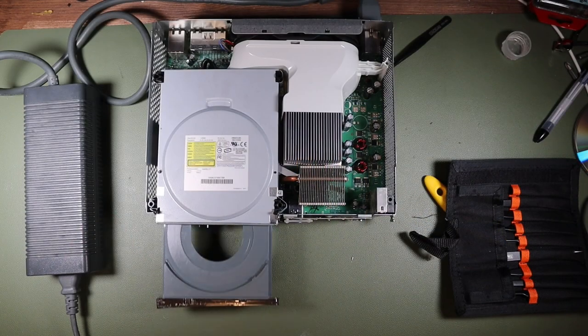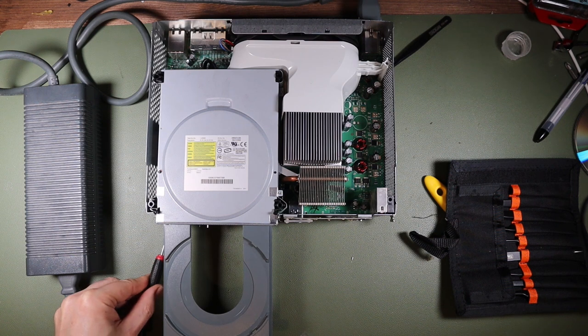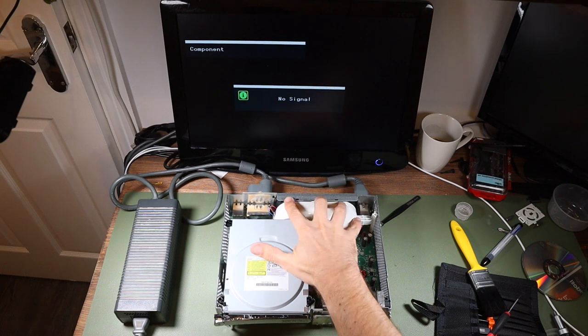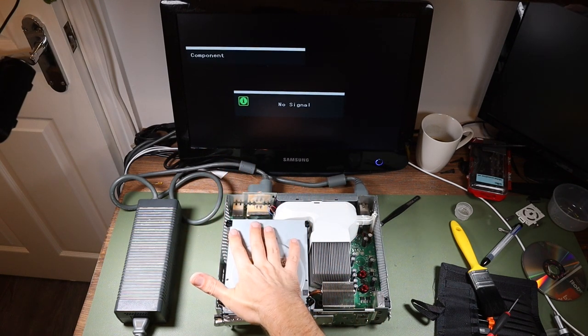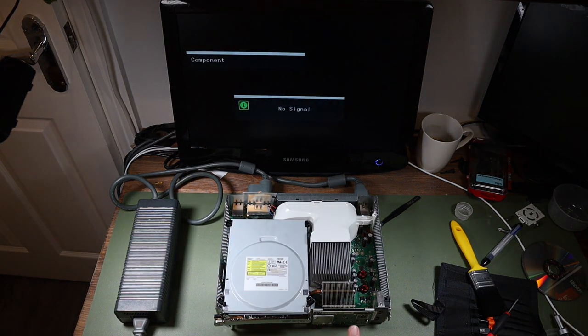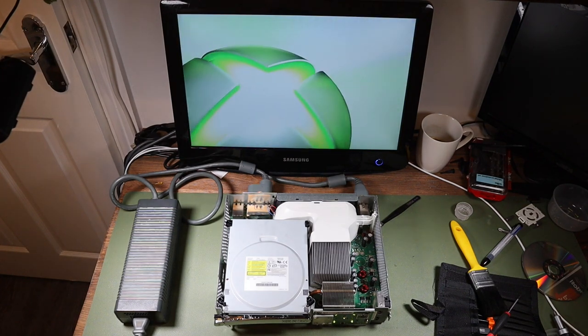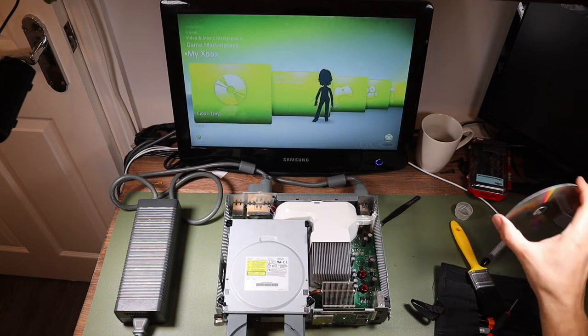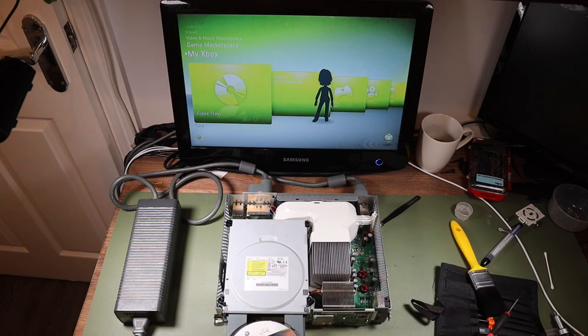Let's try it — excellent! And again — fantastic! I did notice the shroud was in the wrong place, so I reseated that and the disk drive is now in a better position, and I put the eject button in. Let's try it again — excellent! Now we get the startup screen, the drawer opens, and I have one game disc — Halo 3. Close, it's reading the disk. Is it going to read the disk? We did clean the laser. Come on — yes! Play game — and it shows us Halo 3. Fantastic.